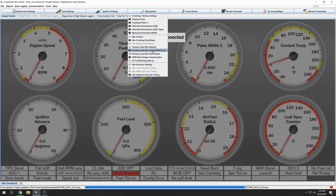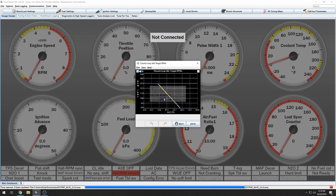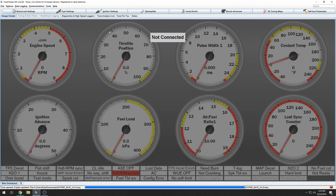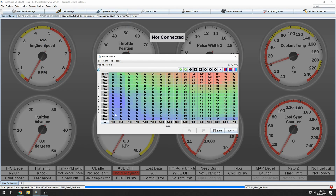One other thing: the Target RPM curve. This is basically what the car is going to be targeting as it warms up. Once the car is warm, we're going to target 850 RPM — basically from around 140 degrees and on. Set 150 to target 850 and then 170 to target 850 as well. This allows it to interpolate better as the engine approaches normal operating temperature of around 190 to 200 degrees.